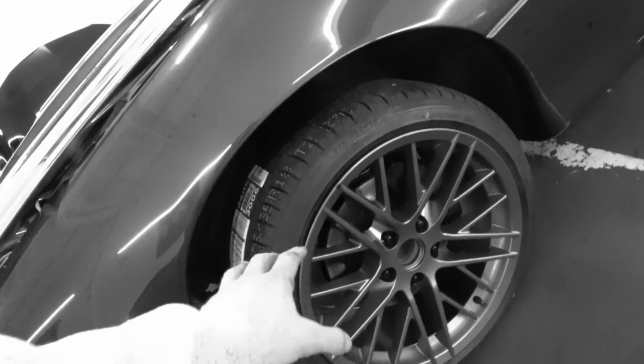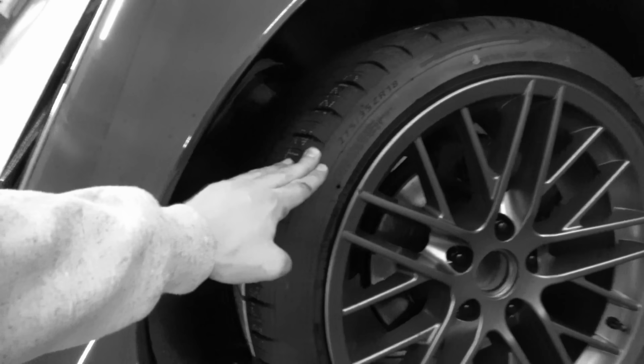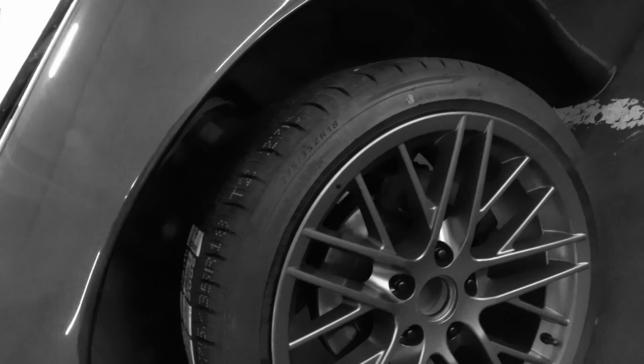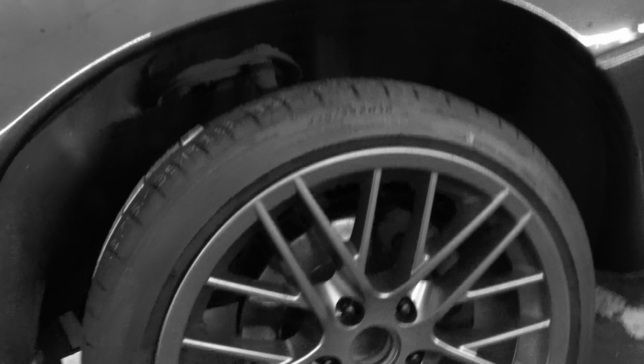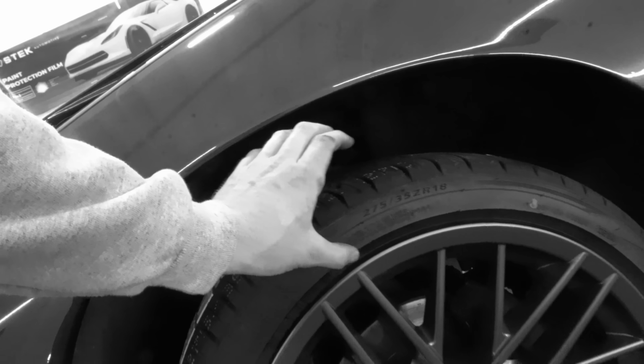So after staring at this for probably a solid 15 minutes of not even saying anything, just looking at it. 10.5s on the front look good. Definitely gonna have to do a bigger tire, like a 285/45 or 285/40 something. That'll make the sidewall a little chunkier. Mission failed. So now I'm gonna go ahead and throw the stock wheel back on, put a bigger tire on so I can put these up front. Definitely still need to do suspension because this thing is sitting tall. That's one reason I wanted kind of a chunkier sidewall, was to hide how fucking monster truck this thing is.